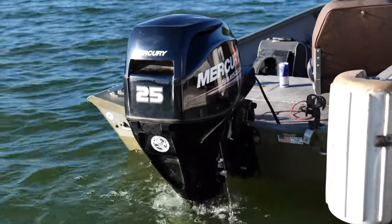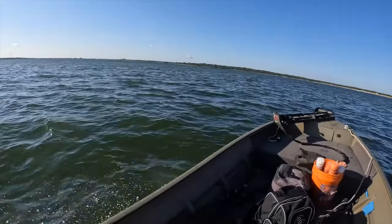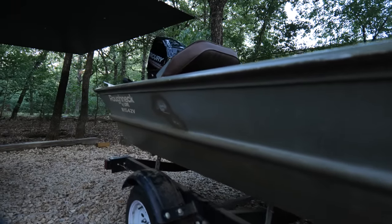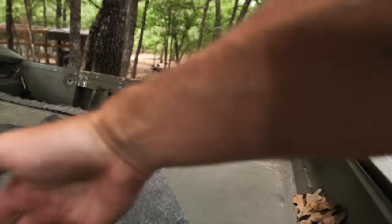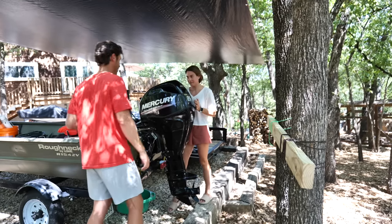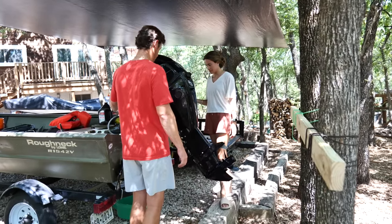So the Crispy Collector gets me from A to B, but she has a serious problem right now with the motor being mounted - it's way too low in the water and we need to bring that motor up. One of the biggest things we could do is add a jack plate. She definitely ain't the prettiest thing going down the road and she's got some character, but we are going to make a big upgrade on the aesthetics by putting in some new foam decking, taking out the nasty carpet that's bad on the equipment, slides around, rough on your knees, really just nasty and falling out. I did repower it in 2019 with a new Mercury four-stroke EFI 25 horsepower, so the first thing we got to do is take this big motor off to get started.